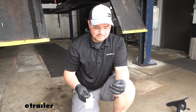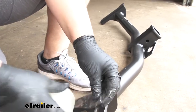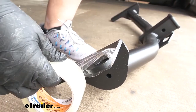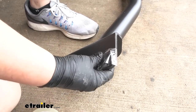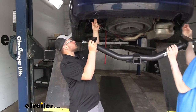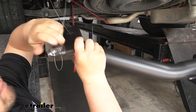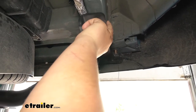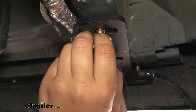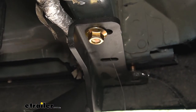Our kit's going to include these angled spacers — we want to grab these and we want the slope facing the rear just like that. To make it a little bit easier on ourselves, we're going to tape this to our hitch before we install it. You can just grab some packing tape and run it around there, then cut that hole out using a knife. We'll be doing this for both sides. Now with an extra set of hands, we want to start lifting our hitch up into position. We're going to feed those pull wires through the according holes in our hitch. Once we get those pull wires through, we'll start lifting our hitch up into position, then unthread our pull wire. We just want to grab one of our flange nuts and carefully get that started — once we get one started on each side, the hitch will be able to support itself.